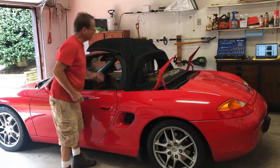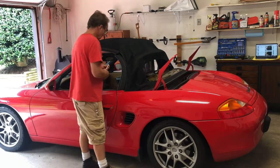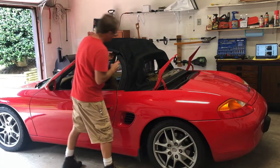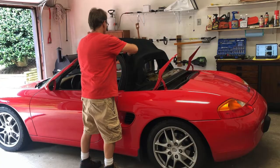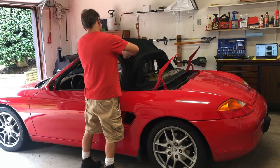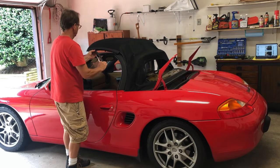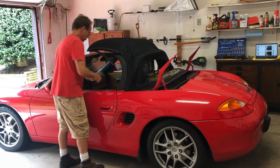You don't want to get it scratched up. Next, you're gonna want to go in. I had to slide the top open a little further to expand this gap. And I'm going to use a flathead screwdriver and try to get this top piece of rubber, this rubber trim, out. Stick it in the bottom under there. It's got a little bit of adhesive on it, so it's a little bit to get started, but once you've got it, try not to rip anything. And then just to there, because on the corner it's actually screwed in.